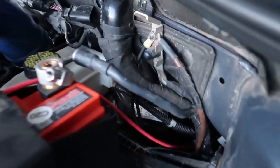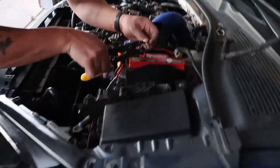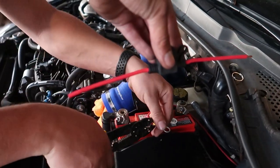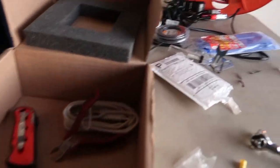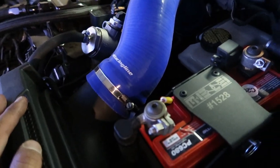Battery's back in. Got the power wire brought up, going across, cut it to size — stick it right there on the battery positive terminal. If I ever go somewhere sketchy, I can just pop the hood and disconnect it so the fuel pump won't work — a little anti-theft bonus, or just unplug it from the back. Almost thought we were done but forgot the fuse — cut the head off and installed the inline fuse holder. Everything's on, connected it, heard the fuel pump prime — and she starts right up. Hell yeah.